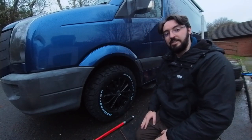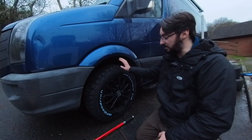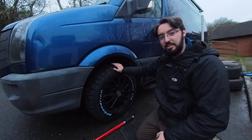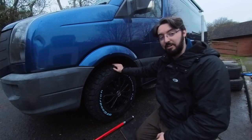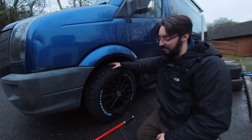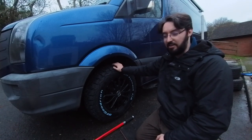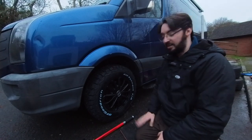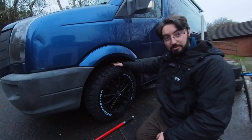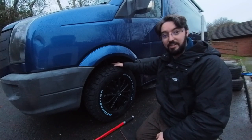One of the last things I want to say is I weighed the original steel wheel with the tyre on it and then weighed this one. The original steel wheel was about 27 kilos and this one was about 32, so with four of them that's adding about 20 kilos of weight to my van — and my van's pretty close to the limit. So it's just worth bearing in mind that it's not always replacing like for like when it comes to weight. Anyway, that's fitting tyres and wheels on my Crafter. Don't forget to subscribe to the channel, like the video, leave a comment, let me know if there's anything you would have done differently, and I'll catch you on the next video. Thank you very much.